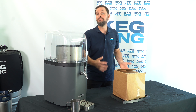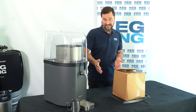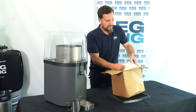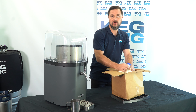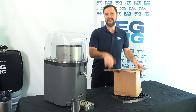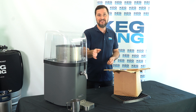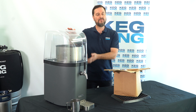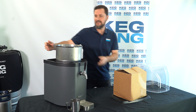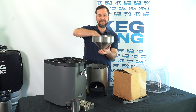The first thing you want to do is get supplied with 10-liter bags of milk. They usually come in a cardboard box that looks just like this. Your dispensing network might look a little different, but mostly all these 10-liter bags come in a cardboard caddy. Here's the 10-liter bag inside already. We're going to get the caddy out, get the bag into our system, and then leave it to dispense under gravity — taking just the amount of milk you need while leaving the rest cold inside the unit. Start by taking off the canopy — this is the milk caddy, which will be situated inside the system.